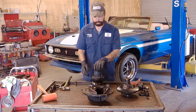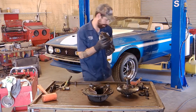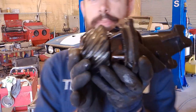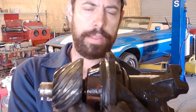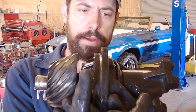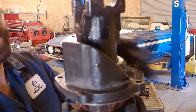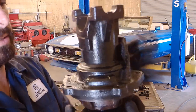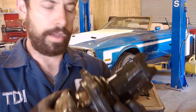There's a crushed sleeve inside here. That crushed sleeve is going to put tension on the bearings on the inside. If you notice how this spins but it doesn't just keep spinning like some super fast ball bearings, there's still some resistance to it. That's the resistance that we're going to be measuring later with the inch-pound torque wrench.